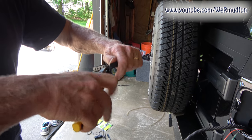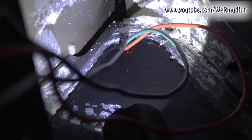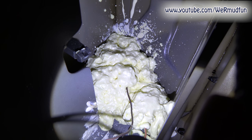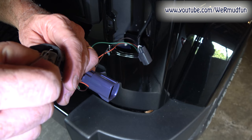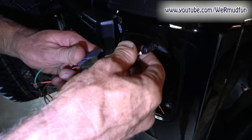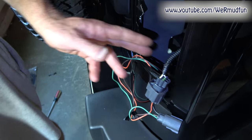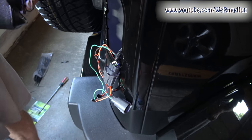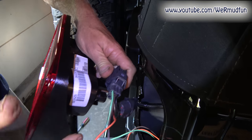Chuck cleaned out all that Great Stuff, and now we have to pop that out. We've got the wires coming up through the plastic, and we reapplied some Great Stuff to fill the area and make sure there aren't any leaks. Throw some terminal grease on here, click it in, and we're going to wait for the Great Stuff to dry, then put the light on. Getting the rest of the terminal grease on the taillight — now we're going to hook it in, seeing how all the Great Stuff has dried.